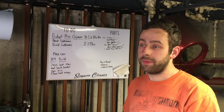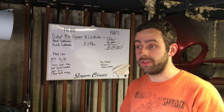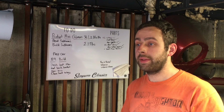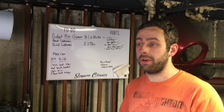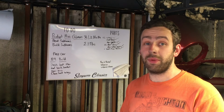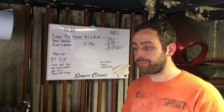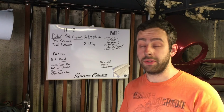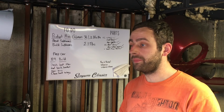Like I mentioned, there must have been heat distortion in that driver's side rear quarter. And what I've done is heat the panel up, push it back. But it still just required a very, very light skim of dolphin glaze just to get it right. Primer's gonna show if I've got it good enough. But engine bay's ready for paint. Boot area's ready for paint, just needs clearing out because it's all dusty again. But yeah, we're getting there.